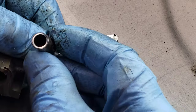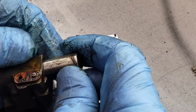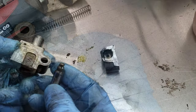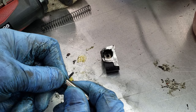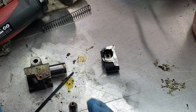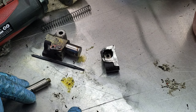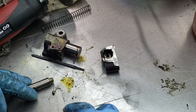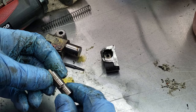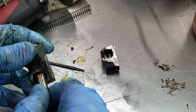This thing was a piston inside a piston and it had a little check ball in there. I think it's made to take oil in and then have a check valve to keep the oil in the plunger so when you shut the engine off it doesn't all drain back. Here I'm taking this thing apart and you can see there's a little cap on it, a little ball bearing, and a spot for that bearing to sit in — so it does look like some kind of check valve. But the piston itself just doesn't seem to have any real varnish on it — very, very small amount and it's mostly on the outside. So I'm curious as to how or why it would stick.